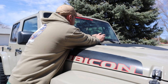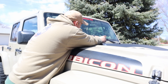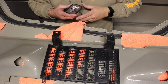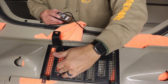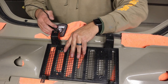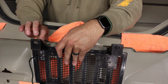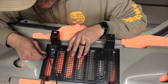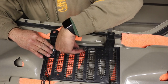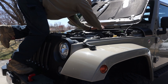All I did here was take some side cutters and cut some of the plastic grating inside the cowl. Took the cowl off for better filming, and tightening this bolt was kind of a pain. If I were to do this again, I'm going to put double-sided tape underneath the antenna just to keep it from spinning. The bolt holds it in place, but it will turn and twist a little bit. I did break a couple of the plastic body mount clips in doing this, so plan on having a few extra of those around when you do this project.